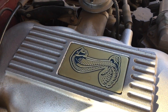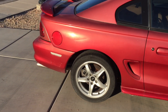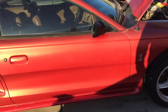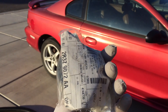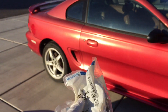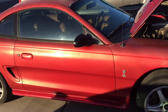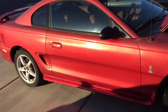One thing I noticed last night — I was filling it up with fuel and it got to the top and started spewing fuel out. As my brother was following me home, he said when you take turns it's dumping fuel in the back. That had happened before when we changed the fuel pump on his 97 V6. It's this filler neck grommet — if you put a new pump in, you've got to really watch this so that it doesn't tear. This is an extra one I have, so we'll be installing it. I'll put links in the video description for the fuel pump install.